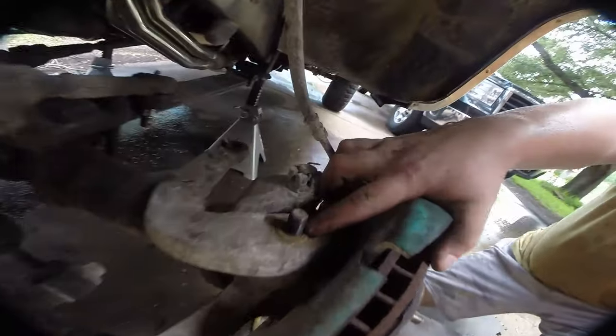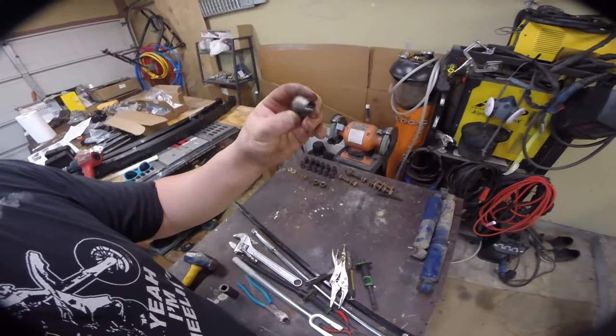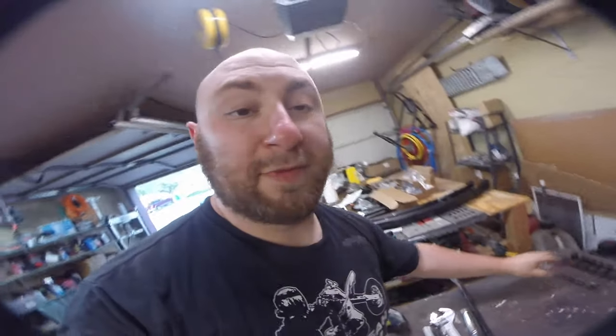What I wasn't sure about was removing this arm. These washers in here are actually conical, so getting them out can be quite a chore. Thankfully, we don't need to reuse that arm, so we can destroy it if we need to. Here are our three cups finally out. This is by far the hardest part of this install — you'll see people cursing this thing all over the internet. This is a mostly rust-free truck from the south, and it took me almost an hour.